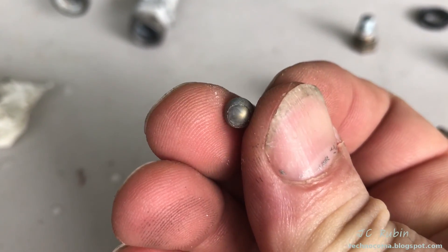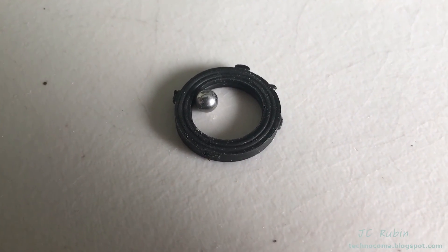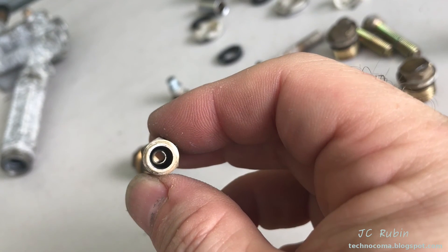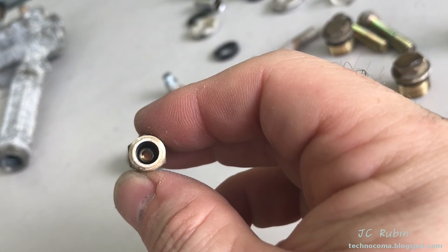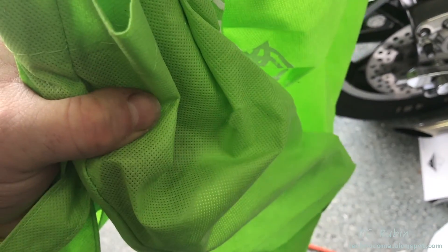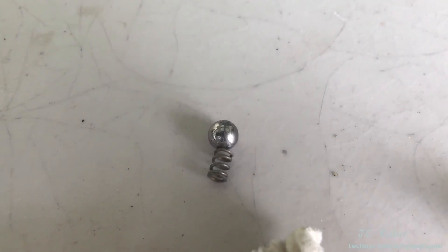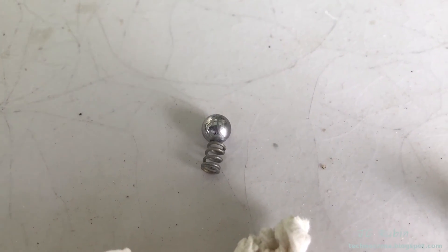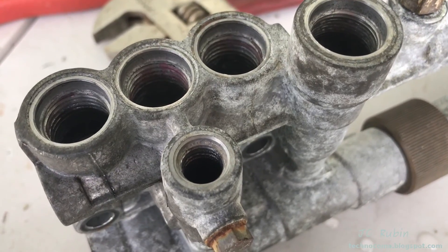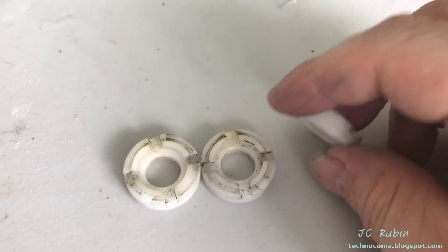You can see a thick coating of calc on there that I'm going to take off with some polish. It's all polished up and that should stop the leak. I'm going to take care of the seat with polish and a Q-tip — you can see inside there it polished up just fine. There's a jet way down in here that I want to blast through with air, so I'm putting the whole thing in a fabric bag and hitting it with my air compressor. This bearing and spring fell straight out of the unit — I'll be able to polish this bearing now too, and put it back in. This is the one from the bottom — it just fell right out.